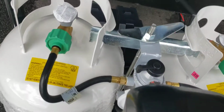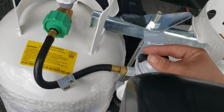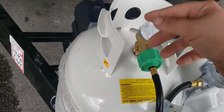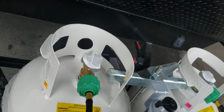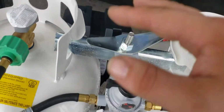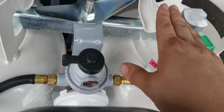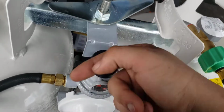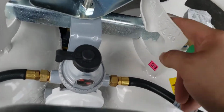They're off now. This is your regulator. Where it's pointing to is the one it's going to pull from first. So if it's pointing here, it's going to pull from this tank first. If this one were to get emptied and this one were to be on, this will automatically switch to pulling off of this tank.